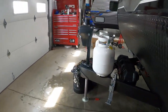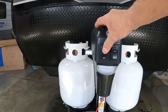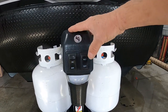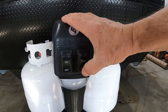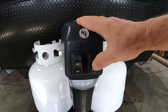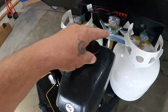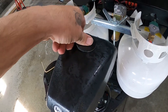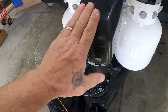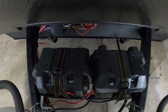Once we arrive and unhook our hitch, the first thing we're going to do is level our unit. The unit comes with a power tongue jack and a night docking light should you arrive at night. Simply retract to lower, extend to raise, and get your unit level. Should you lose power, there's a hand crank right here to get it up and down without power. Speaking of power, every now and then check your battery posts and make sure nothing's worked loose over time.